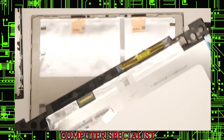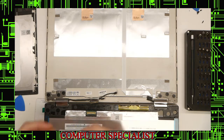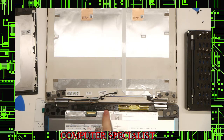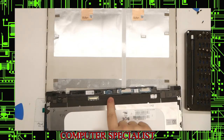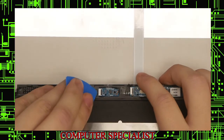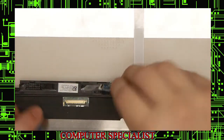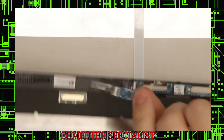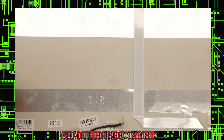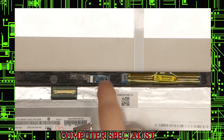Here's the new screen. We're going to lay it down flat just like we did when we took the original one out. This one actually came with a little guitar pick pry tool, but we don't need that because we have our own. Now we're going to go in reverse order. One thing with this screen is that it's missing that little screen lid sensor. We're going to have to transplant it from the old screen — it looks to be held in by some tape and a little tab. We'll wedge our pick underneath, lift up like that, and that pulls out. Transplant that to the new one — and now that sensor is on, so we're good to go.